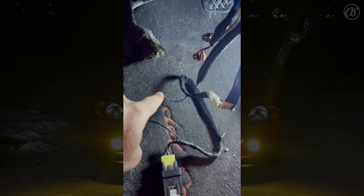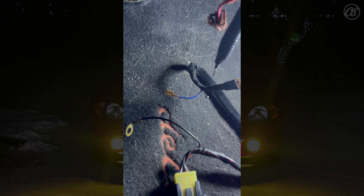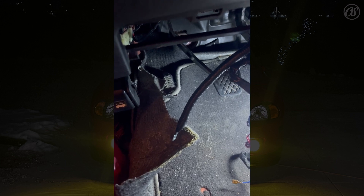Just hit me — I forgot one last wire. You see this blue wire? Where we ran from the dash over — it's tucked up in here. But basically it's going to connect here, same as the connection under the hood. I'll come back and show you — it just kind of plugs in. I'll go ahead and electrical tape it so that connection can't hit anything, ground out, or pop a fuse. Those are two easy connectors, little blue into this, and this wire just goes from the fuse panel through the dash under the hood, and connects to the last wiring that goes under the front bumper.